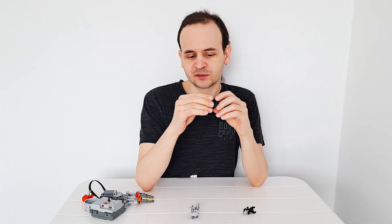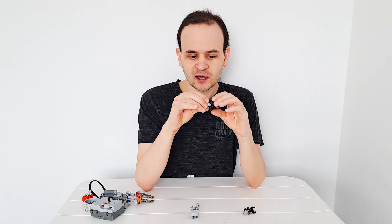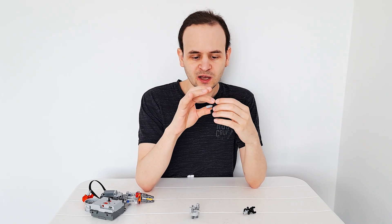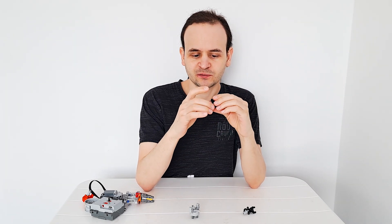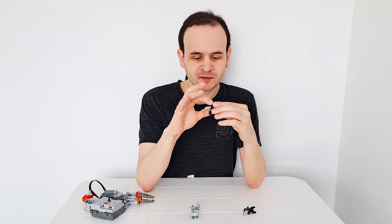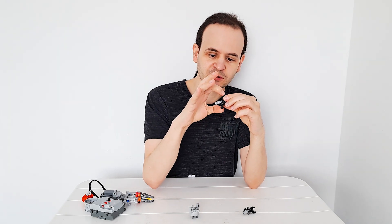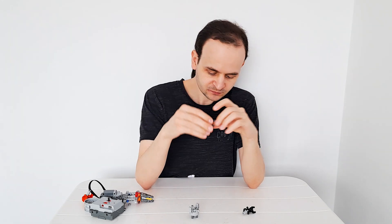The next hub that inspired me is the one used since 2016 from the Porsche onwards. This one uses pin holes and cross holes — it still uses the same CV joint but has the advantage of multiple connection options. You can use ball pins or normal pins, but the negative side is that it's larger, so the suspension arms are further apart and you lose more ground clearance.